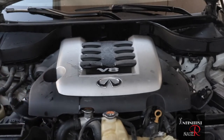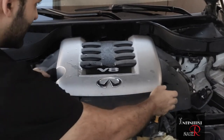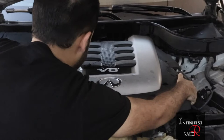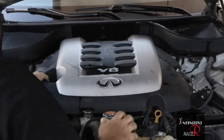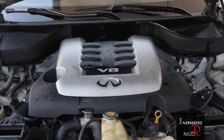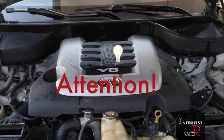But for the V8, by the book it says you have to pull it forward strongly then up. I'm trying to pull with all my strength and it's not opening at all. So I'll tell you the secret: there are four hidden bolts under this engine cover — two in the front and two in the back.